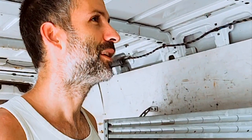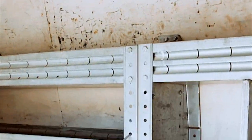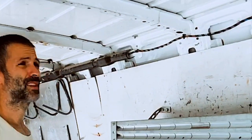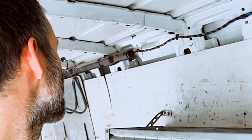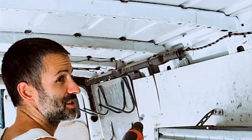We've started — this is day one, well it's probably like day 30 because we've done so much research and shopping for vans. We got the van yesterday and we're starting to take out these quite beautiful aluminum racks. They're just not useful for us, so it's just a bunch of screws. Unfortunately they used self-tapping screws to go into the chassis. We were hoping to use cross nuts or rivets so we didn't have to create more potential corrosion points, but it looks like they just put a whole heap of screws all over the place.